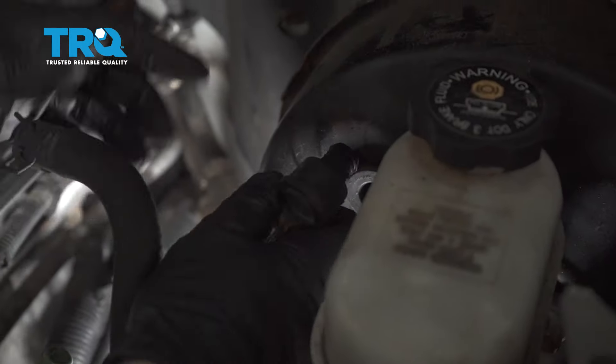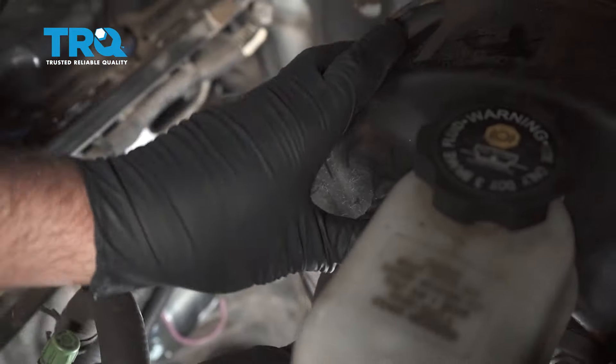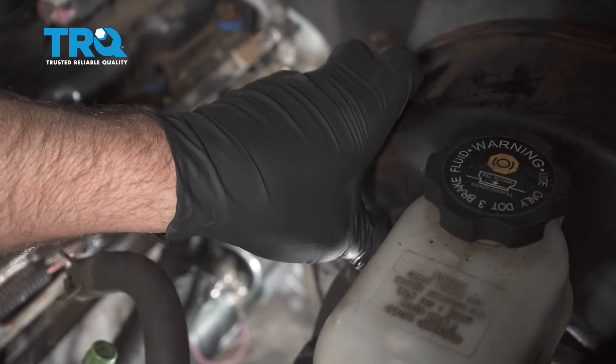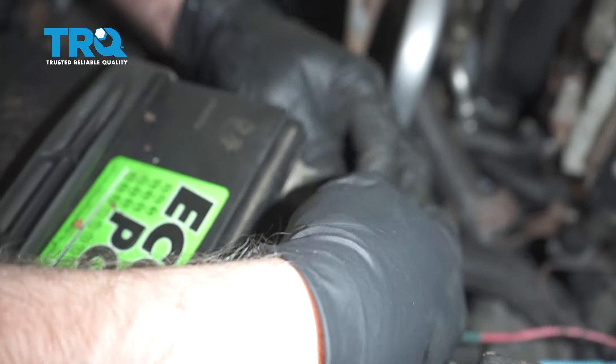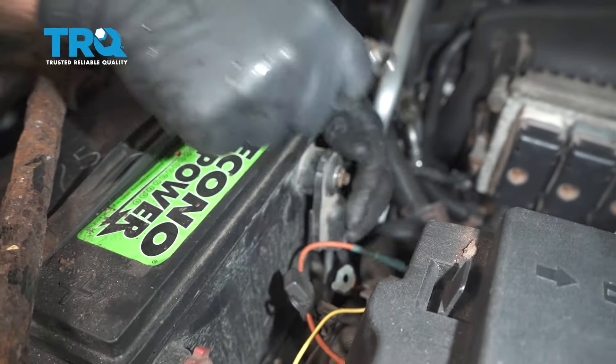After you've done that, if you still have the intake on, put this hose back in place — just slide that back into the booster. Connect the battery, line up the terminal, and snug that up. Make sure it's tight.